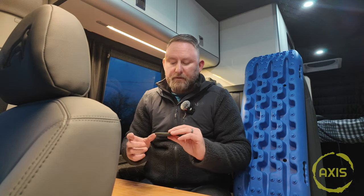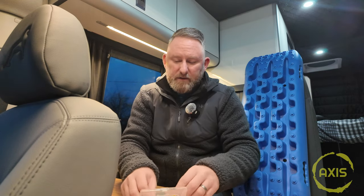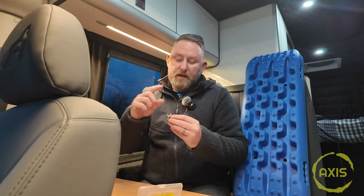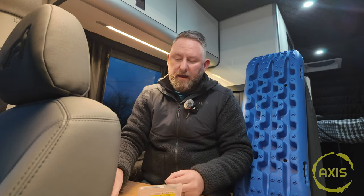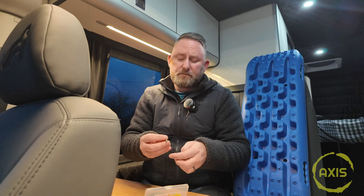I've got a set of these right now. They do these in different sizes, so you can have a look. I'll put a link at the bottom for what I paid for these. These come with an M6 internal thread and also a pack of bolts, but they're tiny — you're not going to get that mounted through the traction board; the thickness is bigger than that. Basically, get yourself some 6mm threaded bar if you're stacking two together, poke it through, and cut it to where you need it. What I ended up doing was getting some M6 bolts — nothing massive, just enough to go through, grip it — with a lock washer and some big washers. I sprayed the washers black because they look a bit rubbish in silver.